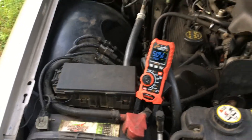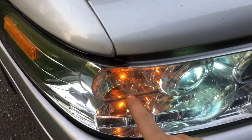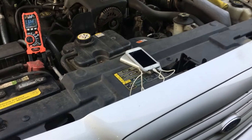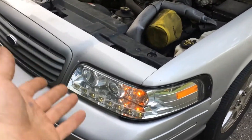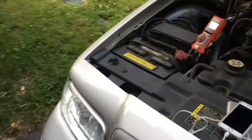I really should get LEDs for these, because those things draw a lot of current. About seven amps for the HIDs, and about six for the parking lights front and back — so six and a half. All those parking lights — that's why you want LED. I got these high-powered HIDs and they're using the same current as the stupid parking lights.